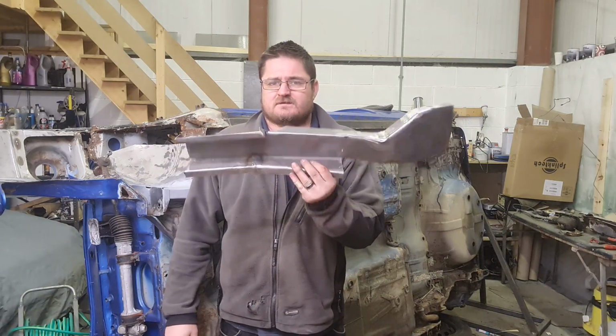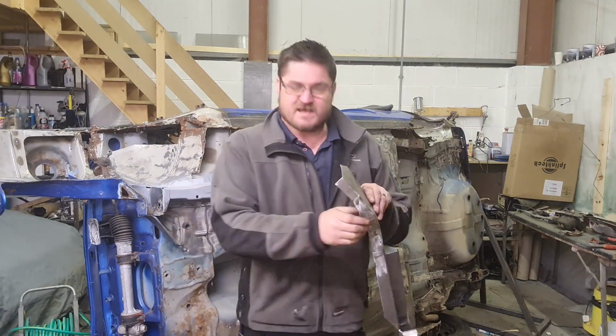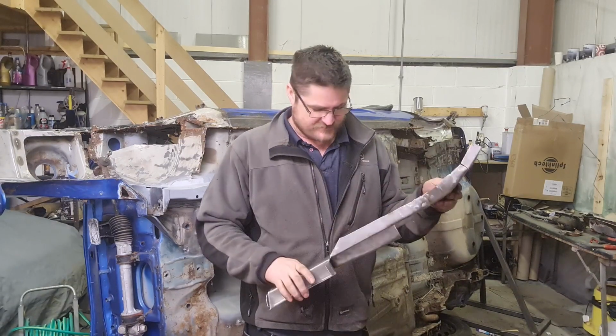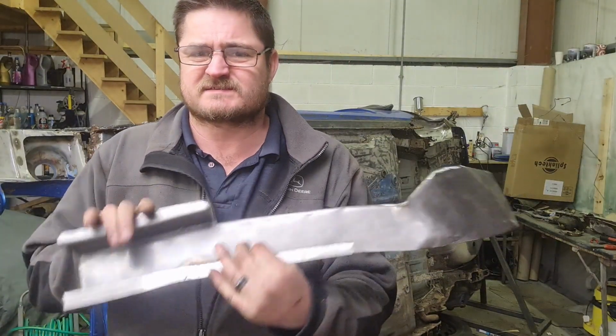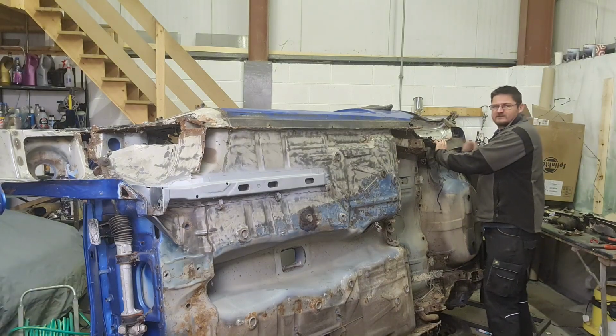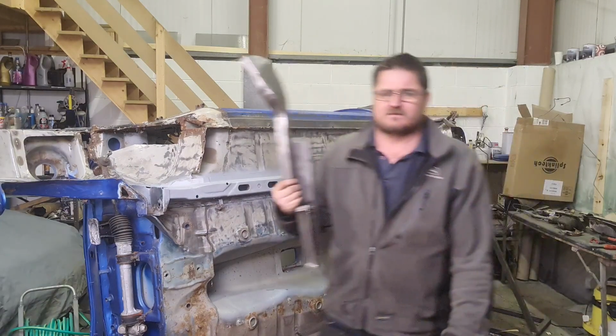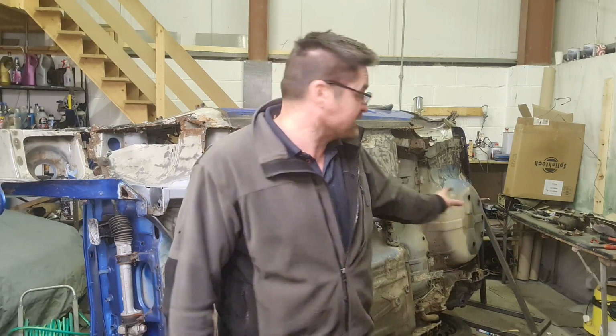There we go. That's the rear chassis leg made. It wants a little bit of cleaning up here and there. I had to bring some gear home from work so I can get into little nooks and crannies, but other than that, that's made to replace the bit that I've cut out from there. When I get this cleaned up a little bit more, we'll get it fastened on in the next video. A tiny little bit of fettling here and there I've got to do just to make it right. That back corner's done and absolutely sound, ready to start cleaning up, ready for paint.